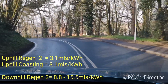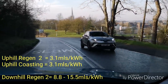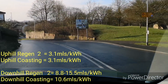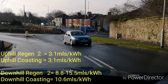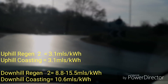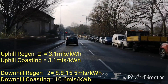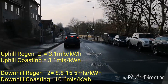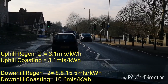It's already at 8 miles per kilowatt hour, and at the junction it was 8.8 going down in regen — and now it's going to be 10.6. So coming downhill in coasting was better for me than regen — not what I expected. Marginally different, but it might be due to just 10-20 meters more of downhill on the regen run. It was so marginal I would basically say it was pretty much the same result.